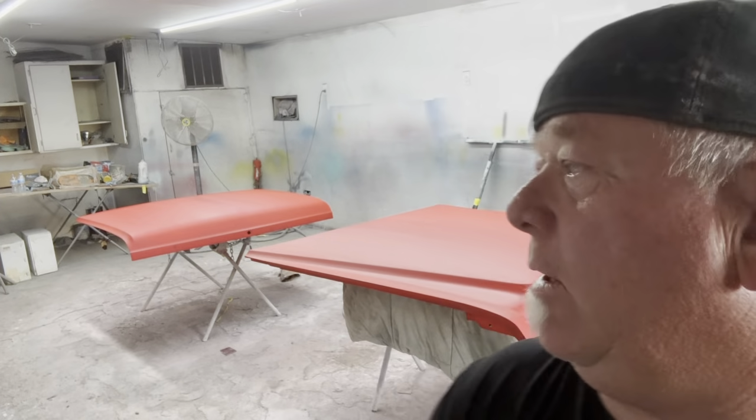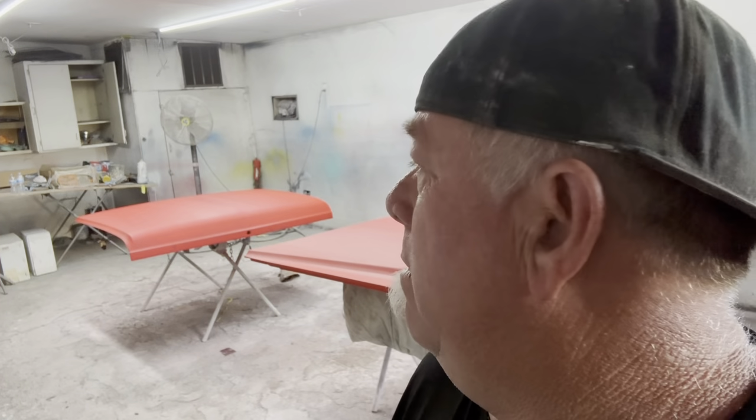All right, for every paint job, in between sealer and paint, you need to tack it. I double tack. I use an old one and a new one, or a newish one, and I go over them twice to make sure I get all the residue off. You don't want to leave any dust on this thing, okay? You can see they're all red now, but they're a little bit transparent. That's just the way it's going to be unless you put two coats on. But it's way better than being white, trust me, because you'd be putting two coats of paint on just to get kind of red. It's already red. Now we're going to paint it and clear it.